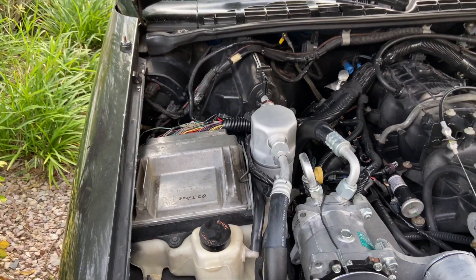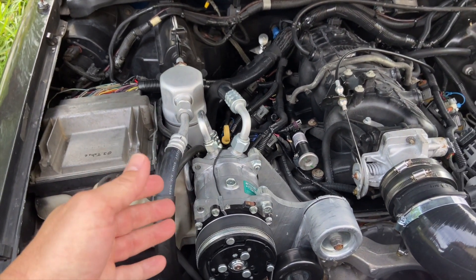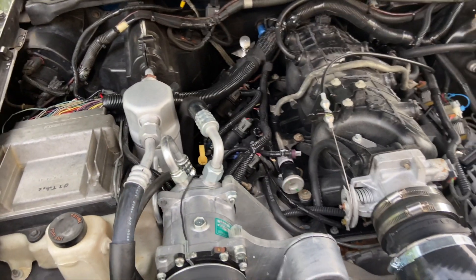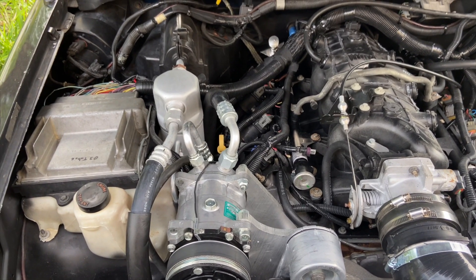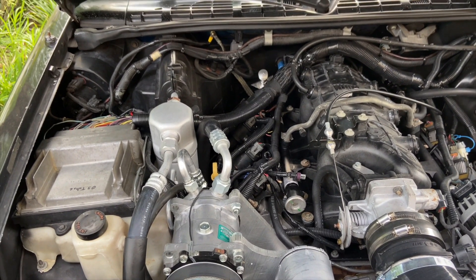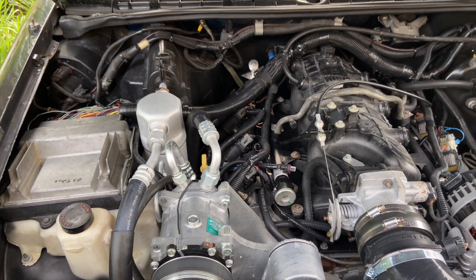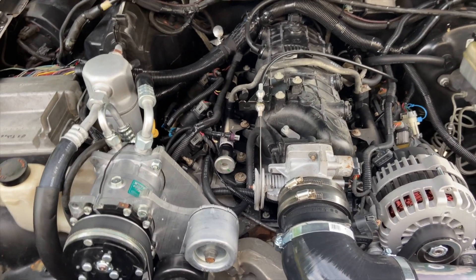In all honesty, I don't know why the AC even works like this, because technically the computer should not be telling the compressor to come on — but for some reason it is. It's just always telling it to come on and never tells it to turn off. I don't even have the pressure sensor plugged in right now. If I ever want to try again, it would just be a matter of unplugging the trinary switch and plugging that sensor in. The second wiring diagram will show you how to do it if you don't want the computer involved at all — just cab controls, completely analog. I hope this helps you figure out your AC system for your hot rod build. Thank you for watching — hit that like and subscribe button!